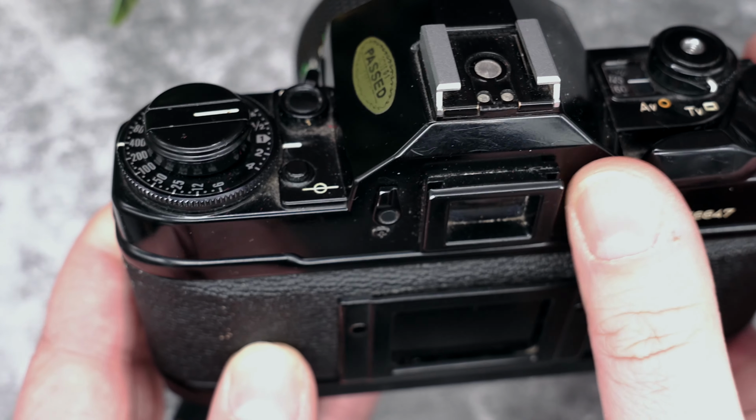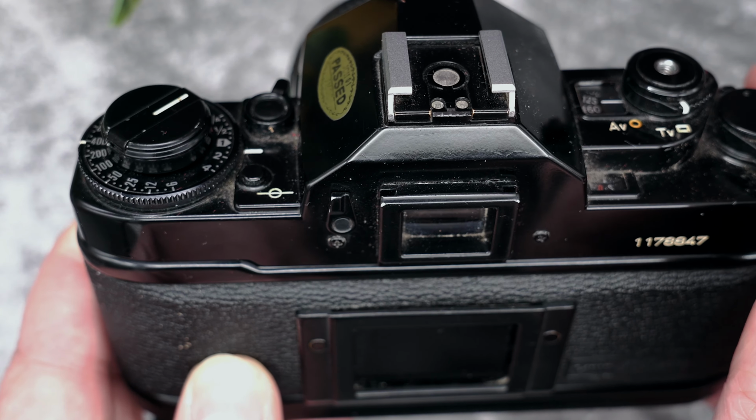Then after that, you probably want to fire one shot. I just do the one, just to get rid of the exposure that we've just seen there that's completely blown out. Move it on. And this is the point where you'll find out whether the battery is also working in your camera. A lot of these older cameras don't necessarily need batteries to work, but the Canon A range do. The battery goes in here. So that's the next thing to do, is I'll try to fire the shot, and if the battery is all good, then it should be fine, which it is.